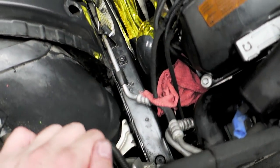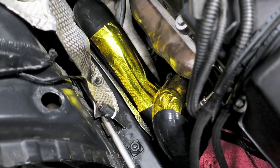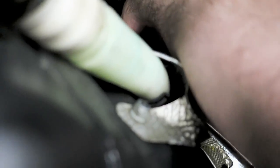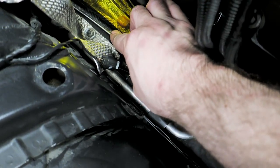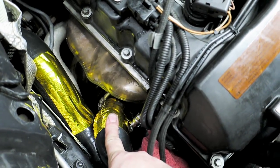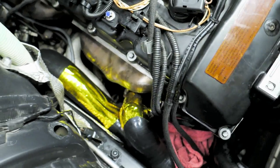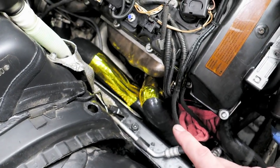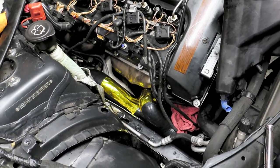You don't have to cut the rear outlet — just put that on straight. You have to cut the front one to size because it's meant to fit on multiple vehicles, not just an E90 or E92. Nothing's bound up, nothing's getting pinched, it looks fine, it still moves freely. The only tricky part is this front outlet has to be cut to get some gap — rotate the tube, lock everything down, and make sure you wrap it. It's not included with the kit but it'll give you peace of mind. You can buy this reflective tape at your local auto parts store.